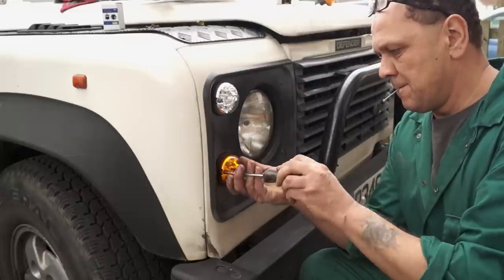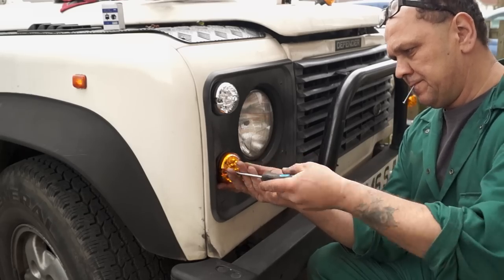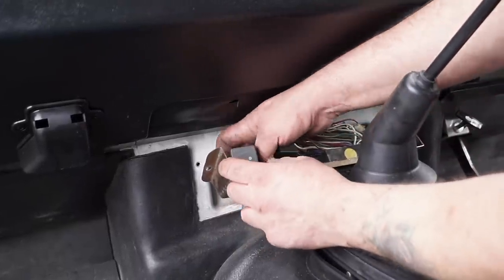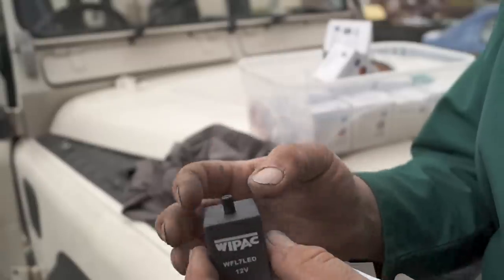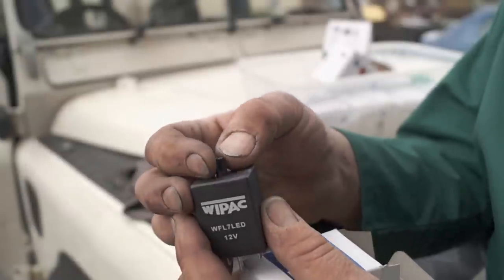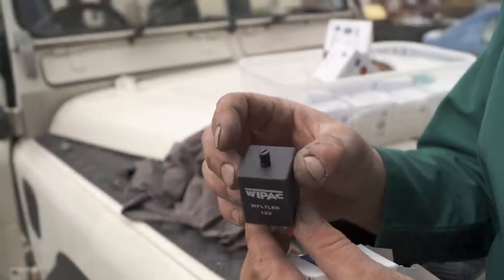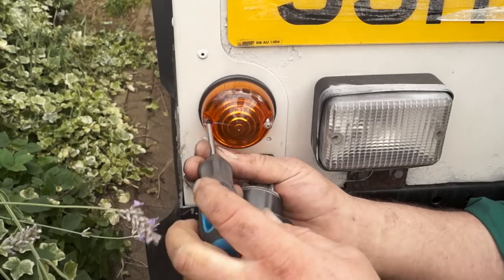Very easy to fit. Just be aware — you can see the rate the indicators are flashing at the moment. This is because of the relay fitted as standard with light bulbs; it's voltage sensed and it knows when a light bulb's out, but if there's not enough voltage provided it will go crazy. When fitting LED indicators you need a different relay. This one is adjustable, so it's going to bring your indicators back to the normal flashing rate, which is 80 to 120 beats per minute — the recommended standard.